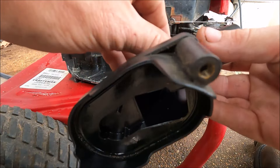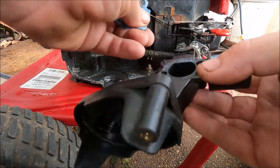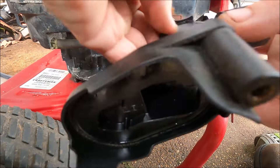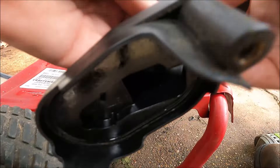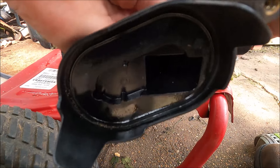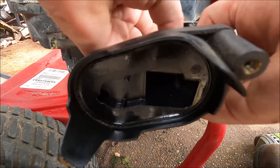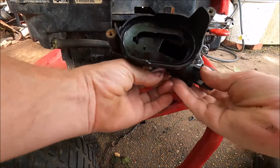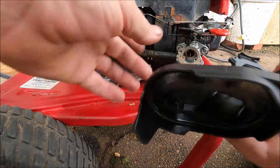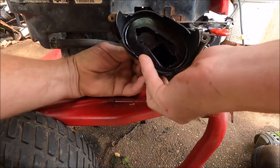When I cleaned the carburetor I made my own gasket, so we're going to take that off because they've got a better one in the kit. It looks nicer - I don't know if it's better, but it looks nicer. Now remember, we've got to put this hose on there, so there's a little bit of manipulation that goes on first.